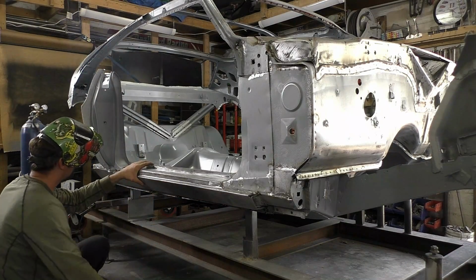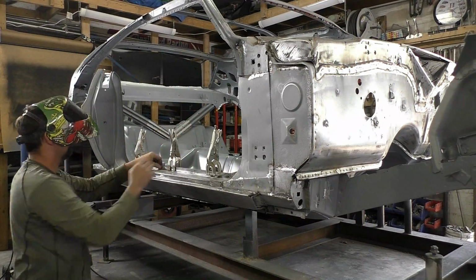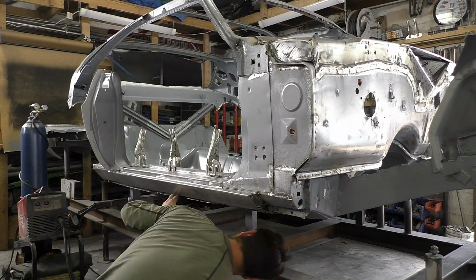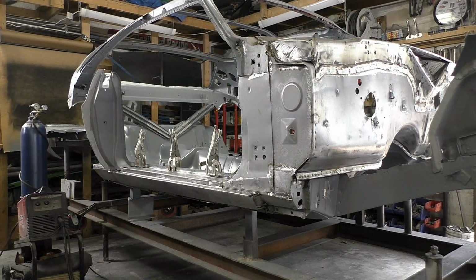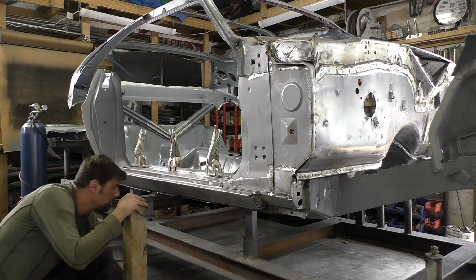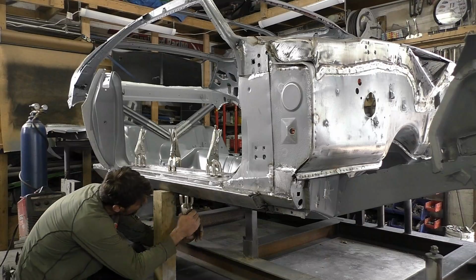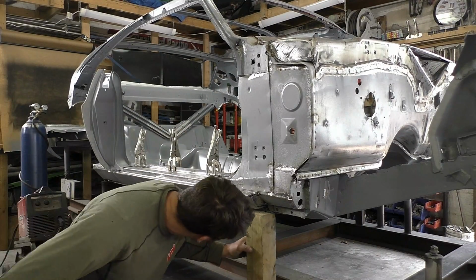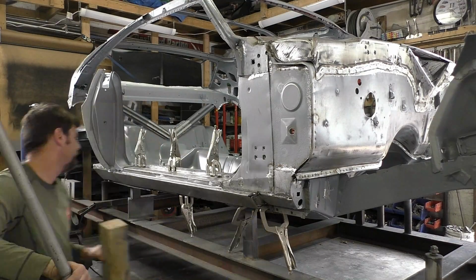With the rocker panel, you could see we installed our rocker panel. Tacking up the rear corners, I want them to line up the best. Like I said, this rocker panel's been test fit and cut down, obviously, a bunch of times, so everything fits really well. After we get done tacking the corners, I'm going to clamp the top and the bottom of the rocker. Now, if you watch other videos and installs of mine, I like to set the lower rocker height off the door jamb height, and basically screw in the rocker till we get our door jambs in there to close the gap.